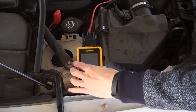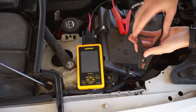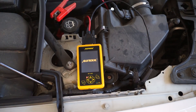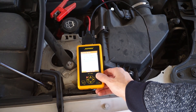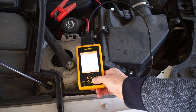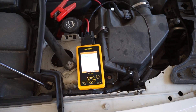Now I'm going to perform the same test in the same car but using the terminals under the hood. As you know, BMW installs batteries in the trunk and under the hood you have positive and negative terminals. Over here we are getting an even lower score — 4% — and that was expected because there is a lot of wiring from the trunk to the terminals under the hood, and those wires add resistance to the system, so a lower score here is expected.